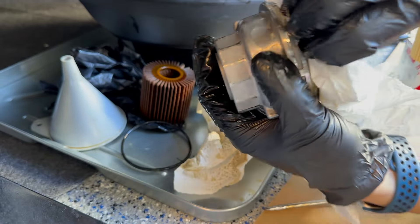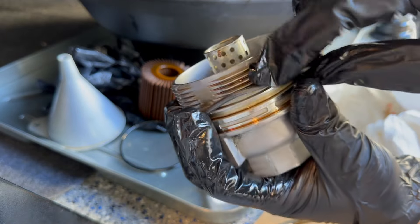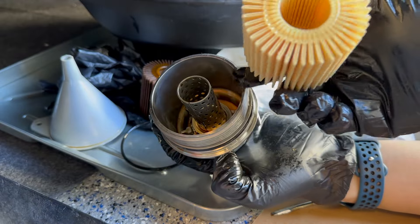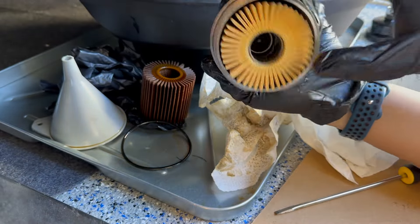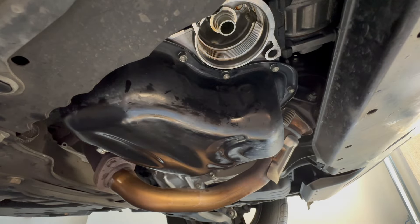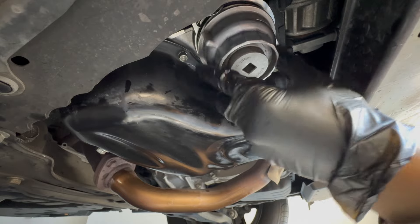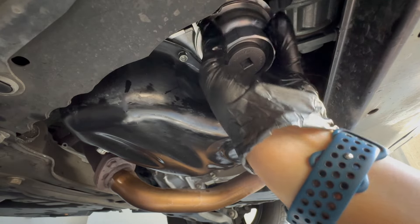There's a little oil residue on the canister — that's fine because we'll lubricate it slightly. Wipe it clean, take the new gasket, and rotate it around until it seats back into place. Then place the new paper filter element at the top — they're pretty much the same, direction doesn't matter. It spins and stays smooth. Put it back into the housing; it should have a nice loose feel at first, then transition to snug.